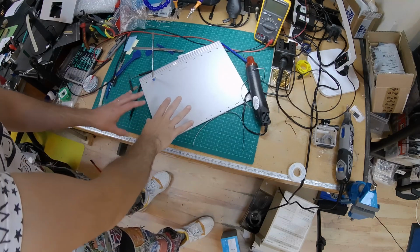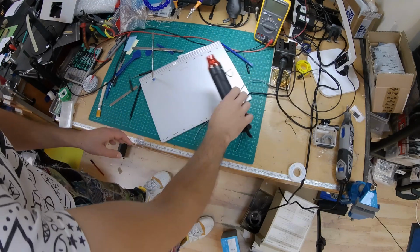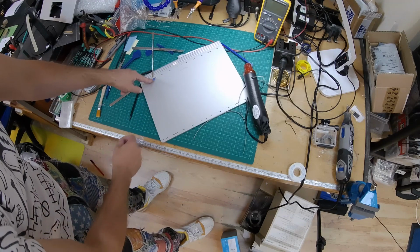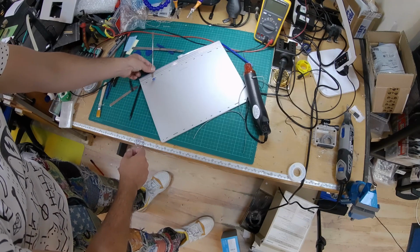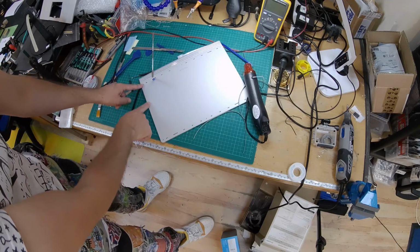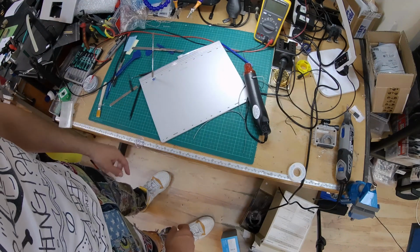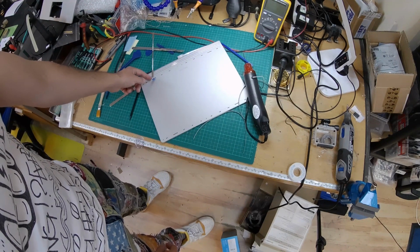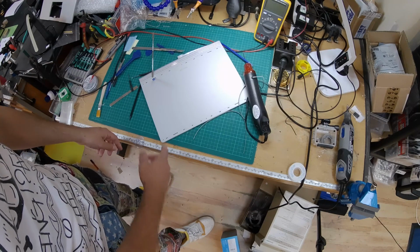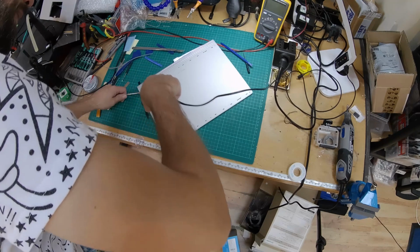Well, after a lot of heating, I did it at 70 degrees. I've been using the heat gun a little bit, and I've managed to get a tiny bit up. So I've poked something through one of these holes, levered it up, and I've managed to get something under there. Now what I'm hoping is that I can heat it and work my way round slowly, removing the adhesive. But actually getting it started is a total nightmare. Anyway, leave it with me. I will keep going, and I'll let you know how it goes.